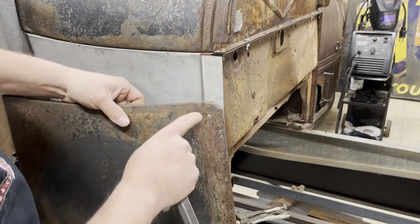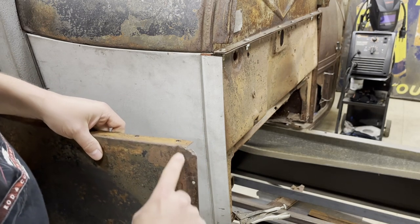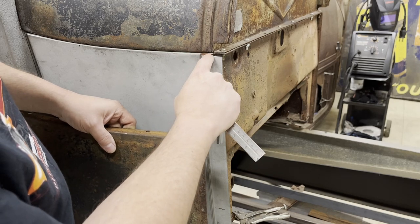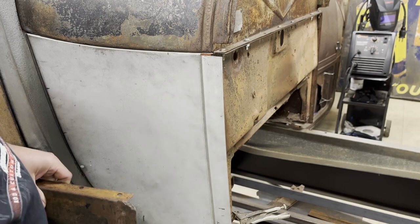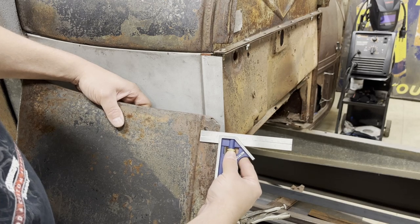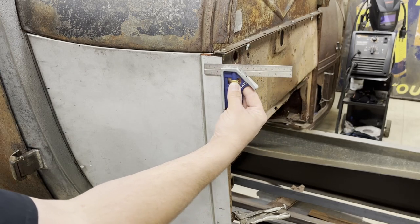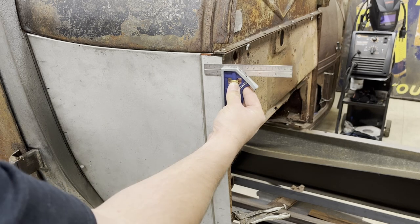You can see that the original panel was solid here, welded together — it probably just was stamped this way. But the way they manufactured this replacement panel, this area needs to be welded right in that area. Another issue that I have is the length of this lip. I've set this square where we can get an idea of how wide this lip is, and when I place the square against the new panel, you can see it looks to be about an eighth of an inch or so too long.